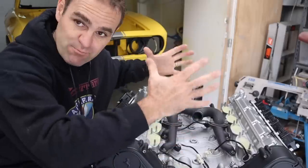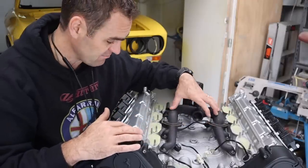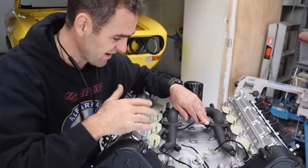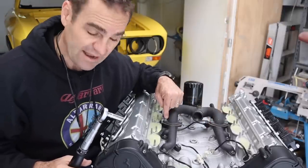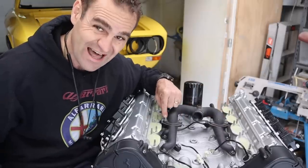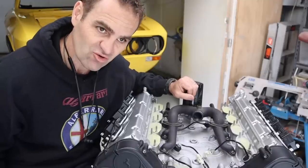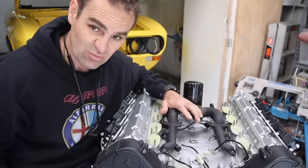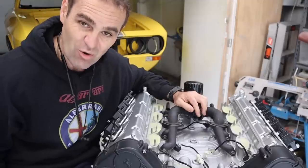Just as I was getting ready to put the top inlet manifold back on, I was bolting on this little water jacket manifold here and I didn't have the correct gasket, so I made up some gaskets myself from rubberized cork to seal up the water galleries. Going through the manual and torquing the bolts to spec, I didn't factor in that the rubberized gasket is softer — and as I torqued up the last bolt, I can see the manifold has cracked all the way through the mounting tab. This gasket probably didn't need that much torque. Now it's cracked and that's a whole new thing I have to deal with.